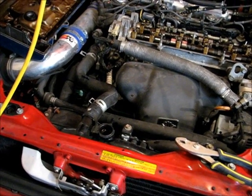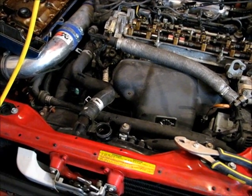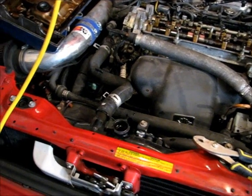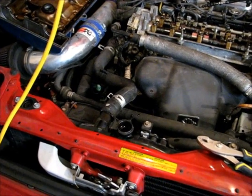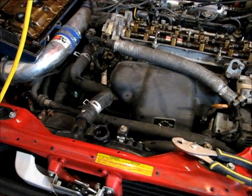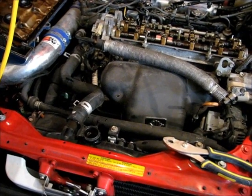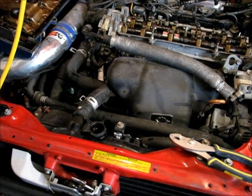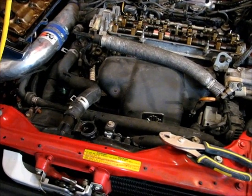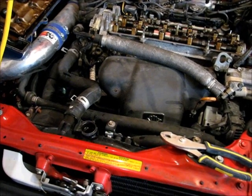So the fluid is running clear now, and so now I'm going to close the radiator spout in the bottom. I'm going to rethread the reservoir hose back up and reconnect it. I'm going to replace the block coolant plug, put my exhaust heat shield back on, and put the upper rad hose back on. And then the system is ready for new coolant to be added.